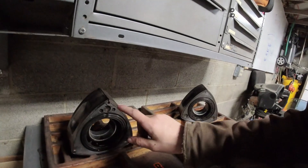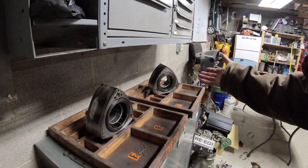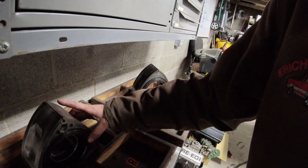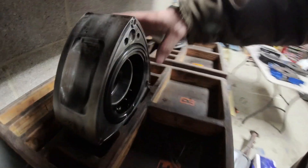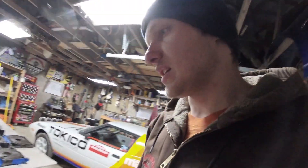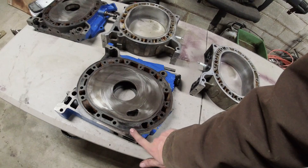As a reminder, the reason we had to take this engine back apart is because the oil control rings weren't seated all the way, which allowed space so those little apex seal two-piece corners could pop out. Here are the rotors ready to go back in — cleaned up, wiped down, seals all clean, re-greased, put back together. The oil control rings, still after being compressed in the engine, are sitting up just a little bit higher than I like. They are new and definitely clamped in further than before, but they're still sticking out a bit.